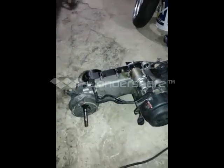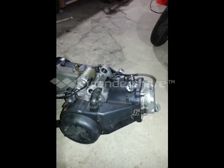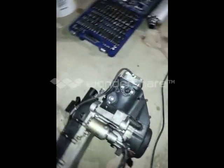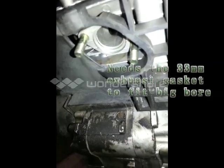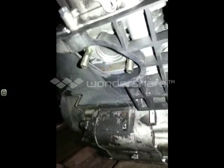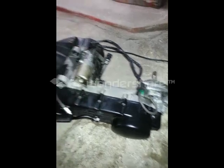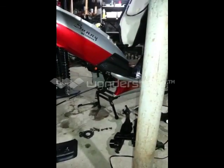Finally have the 150cc upgrade to a 174cc kit done, and now I'll have it all put back together. It definitely has a bigger bore for the intake valve, bigger studs, and a bigger bore for the exhaust, so I'm going to modify the factory exhaust and probably get an upgrade later. For now I just need to bolt it all back up and make sure there are no leaks. There's the scoot.